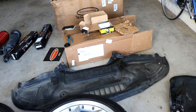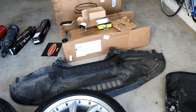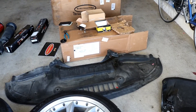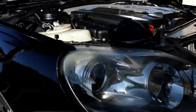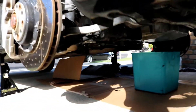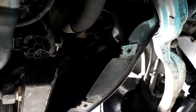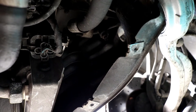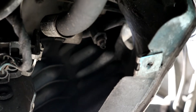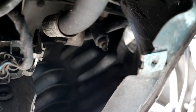Once you pull that shell out as well, you'll have the bottom of the car exposed, because really the only thing you need to get at is the bleeder valve, but it's helpful to have room to see what you're looking at. The first thing you want to do after you get the covers off is to locate the bleed screw for the hydraulic line. There's a nipple right there that's for the 11 millimeter flare nut wrench that will bleed off the pressure for the suspension hydraulic line.